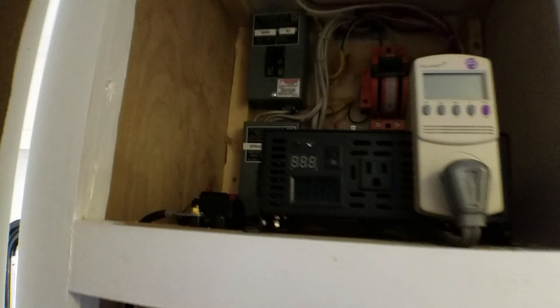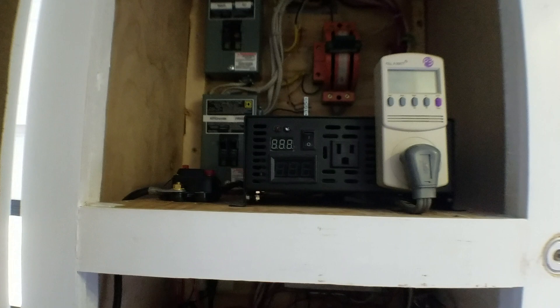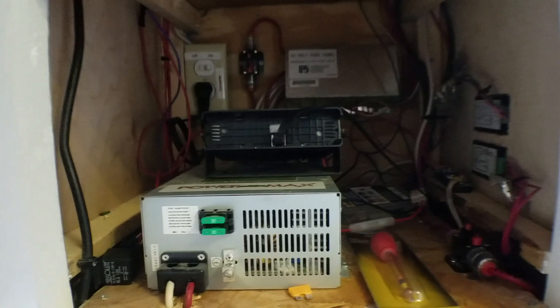You can see all the LED lighting down the roof line here. Next thing I'm going to show you is to the left here — this is the power panel. This is where the electric is. That's the inverters, the breaker panels, the transfer switch I have up there on the right. The switch between shore power or line inputs to the inverter, which all runs through the second breaker panel there. This is my converter, my little ham radio receiver-transmitter there, and DC wiring. DC breakers. I've got to straighten up the wires and clean them up obviously.